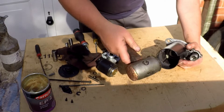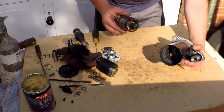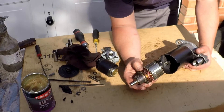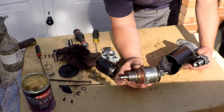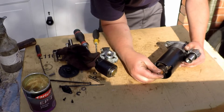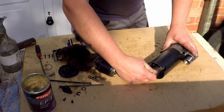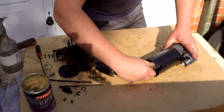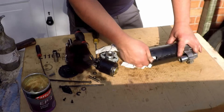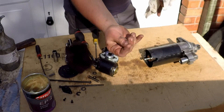These are all little things put in by the manufacturer to help the build process. Now that goes in easy enough - I'm just going to use the copper side of the hammer just to knock it down a little bit. I've already put a little bit of grease on those teeth. Now there being a magnetic field within there, it's suddenly going to shoot it down, so it'll be a lot easier to put the bushes on now. We'll fit that in and then all of a sudden it will suck itself in, and then you've just got to turn it a little bit. And there we go - in. Of course you've got greasy mitts on there, which is where clean cloths come into play.